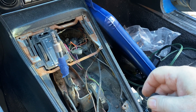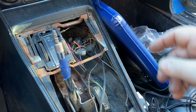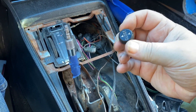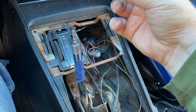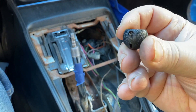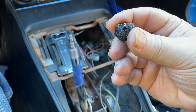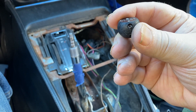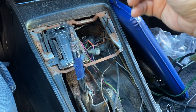Here's one of them: if you have a non-AC car, you'll have these levers with knobs on top. You would think that the knobs would just pop right off these levers, but they do not. There is a small, tiny allen screw on the bottom of the knob — you need to back those out until you can pop them off the levers.